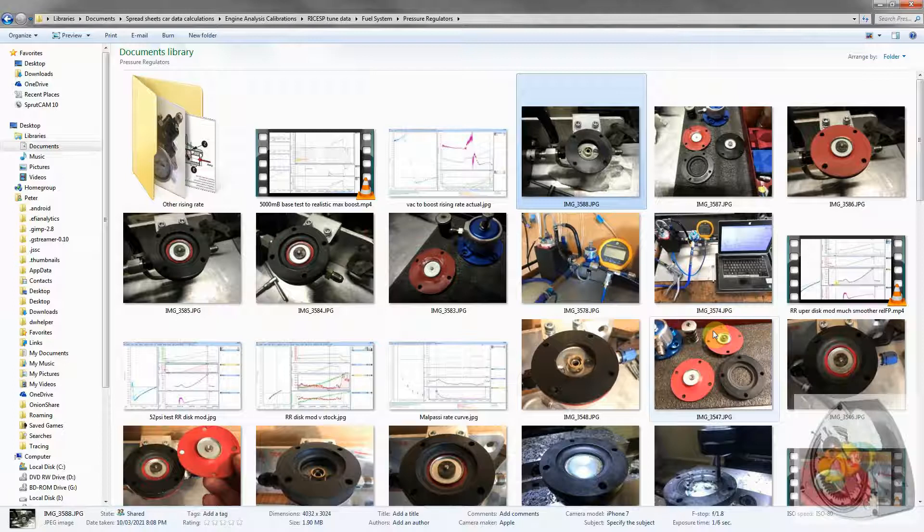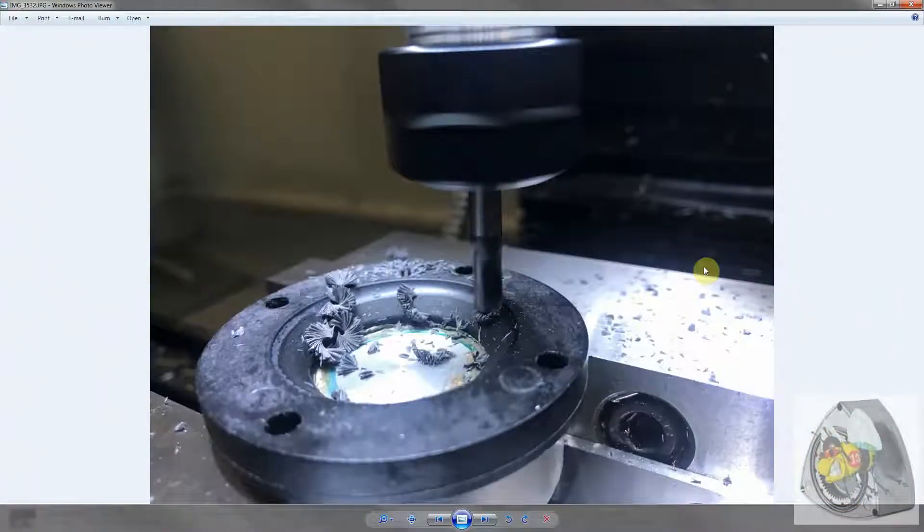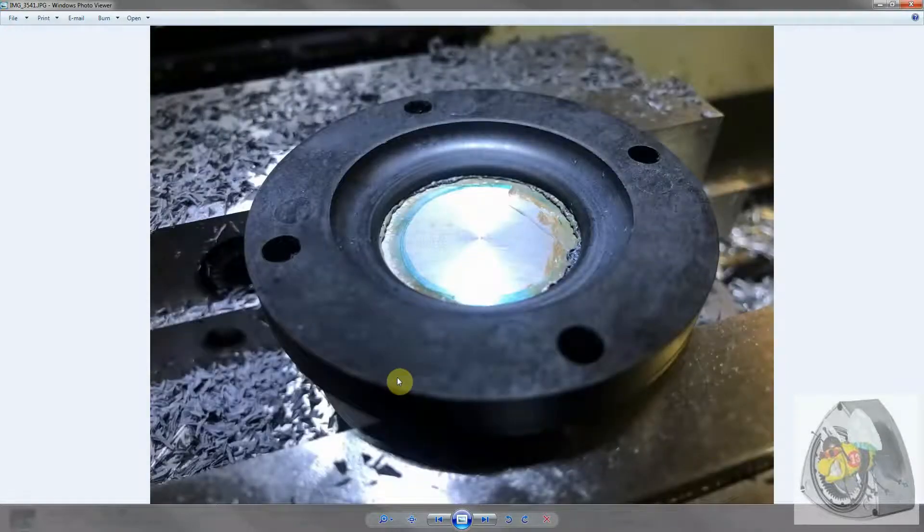Just as a summary, we'll show the modifications that we did to the disc. This was quite a steep taper and the diaphragm was bottoming out halfway down this taper — you weren't even getting a one-to-one rate, you were getting roughly about 0.96 to 0.95. So we just increased clearance, putting a 3 millimeter radius here, and there's more than enough strength to hold the fuel pressure side of the diaphragm underneath.